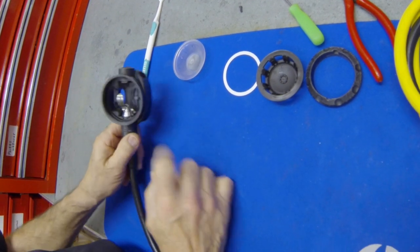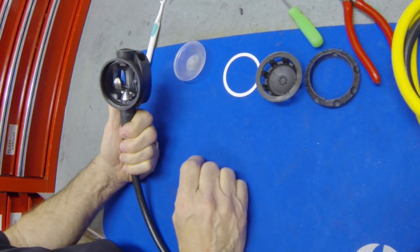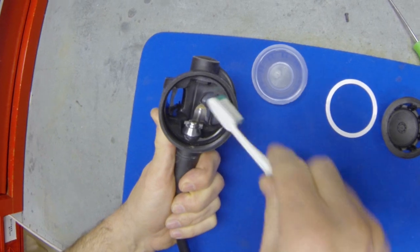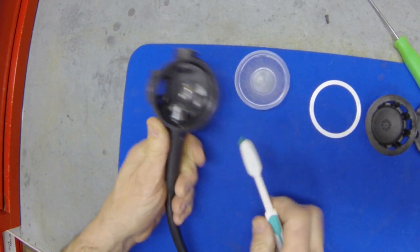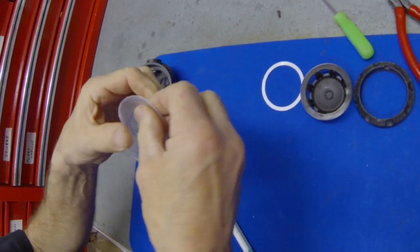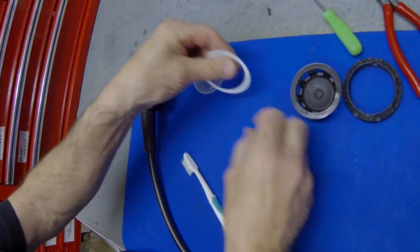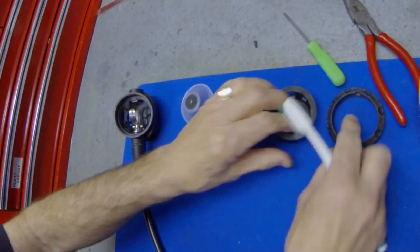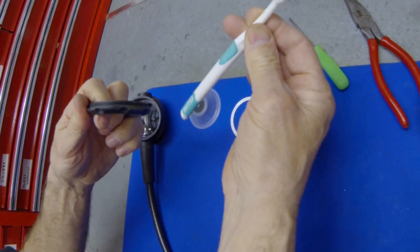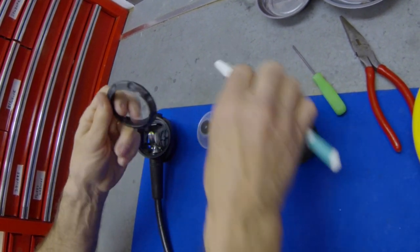So what do you do now? Don't press the lever — if you press the lever and there's water in here, it will go up the hose and hurt the first stage. But now you can certainly rinse this out. Take a toothbrush, make sure the threads are clean. Any sand in there, clean it out very carefully. Make sure it's all nice and clean. The diaphragm is very important — rinse it really well in warm soapy water, then rinse the soap off well. Make sure there are no holes or tears in it, then let it dry. The friction ring as well — make sure it's nice and clean. The cover: brush it up, get all the sand off it. The cover ring will almost invariably have threads — clean those threads off with a brush like this.